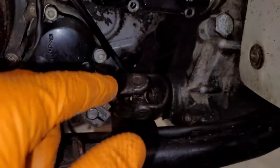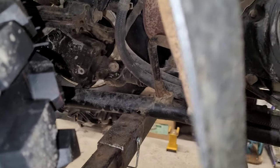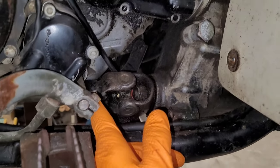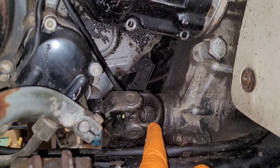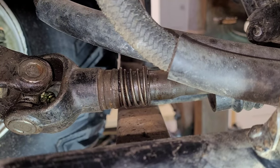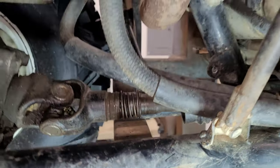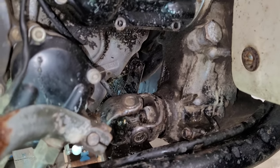This kind of sucks because if you've been watching my channel, you know that just recently I did this drive shaft U-joint as well as the one right over here, and that wasn't fun. I'm hoping that I should be able to slide at least just the drive shaft out, and if I can slide it out I might be able to, between the collar, loosen off this nut — hopefully — and then remove the yoke. After removing the boot there is a little circlip right there, and I'm just going to remove the circlip; that spring should release and I should be able to pull the drive shaft out.